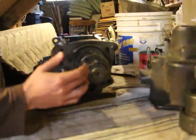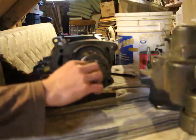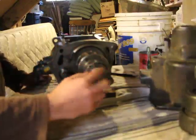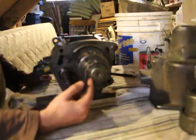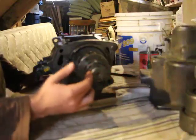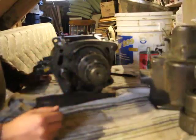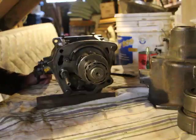So it's a really, really large amount of force here. Just consider that the whole car is riding on, getting power through these rollers here and these little triangles here. These little ramps, if you will. Right? So this steel has to be really high quality, because if it's just soft steel, it'll just wear out.